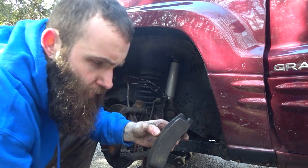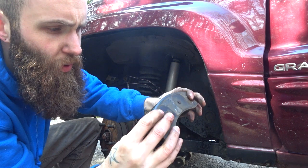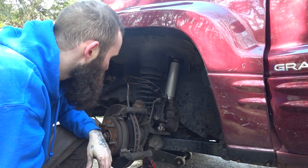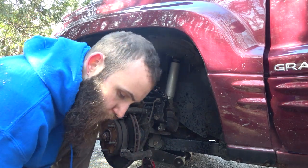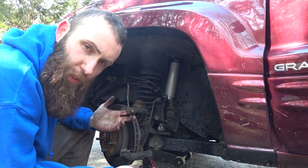See how good these pads are? These pads were put on 10, 15,000 miles ago. But the rotors are completely warped to the point where I'm worried I'm going to break something in my steering hitting the brakes on the highway. It's jumping and jimmy jamming like crazy. So these rotors are coming off and we bought some real funky looking rotors.